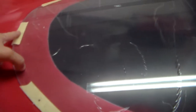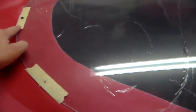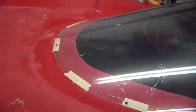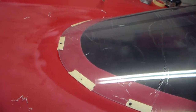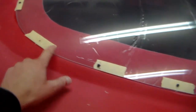I start with the one right in the center of the bottom, get that centered perfectly, and measure up how wide you're going to make the black line of the interior — the paint underneath the glass. That's going to be three-quarters of an inch, so half of three-quarters is three-eighths. I mark the hole there and then work the holes out from there.